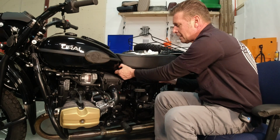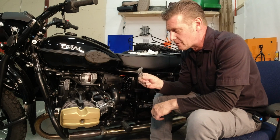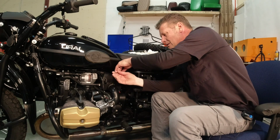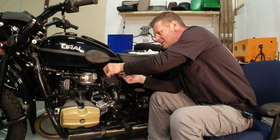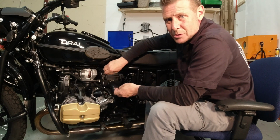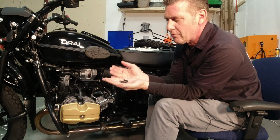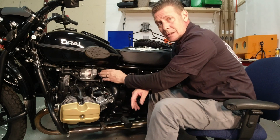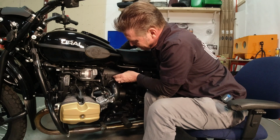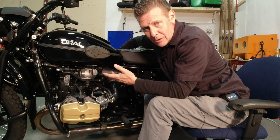I am going to remove the side panel, and then you'll need a 4mm hex key, Allen wrench, whatever you want to call it, and start taking these screws off. There's 4 screws, 2 on each side. So once you get all these removed from the lid, don't leave them threaded into the lid. Take all 4 of these out, don't lose them. Gently move the throttle cable out of the way, lift up on the lid over here, and you're going to want to check for any wires, electrical connectors, anything like that.